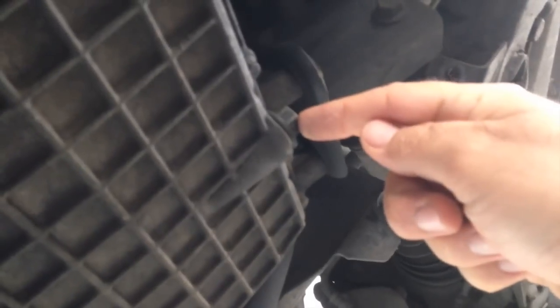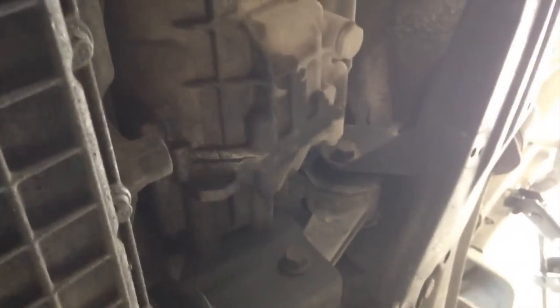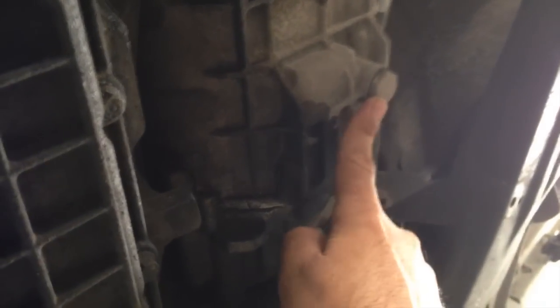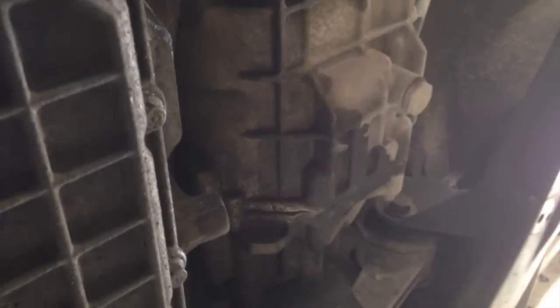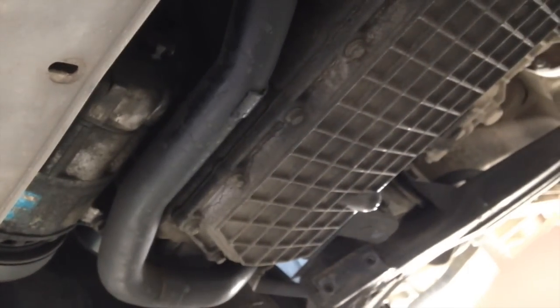Slide under the car and you can see there's the oil sump. If you just go around the corner at 90 degrees, you'll see the sump plug, which we're going to need a 15mm socket wrench to take off. Don't confuse it with this 21mm nut — this is the IRD unit, basically what gives the Freelander its four-wheel drive, so I don't want to be messing with that today. I'm going to squirt it with a bit of WD-40 just to get it going. Then we're going to lower the car down, start it up for a bit, just so we can get the oil nice and hot — not too hot, but to make it easier to get the oil out.